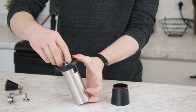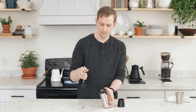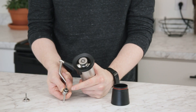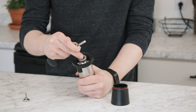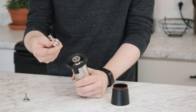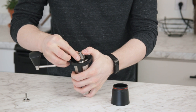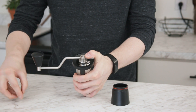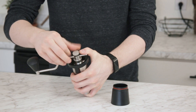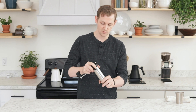Put the adjustment wheel back on and screw it down enough. When putting the little nut back on, note it's asymmetrical — there's one short edge and one long edge that corresponds to the center of the drive shaft on top. It's sort of D-shaped, so align that shape and push it back on. Then make sure the hole in the handle is aligned, insert the thumb screw all the way in and screw it all the way back on. Once that's tight, put your grinds catch back in place.